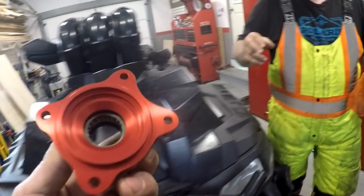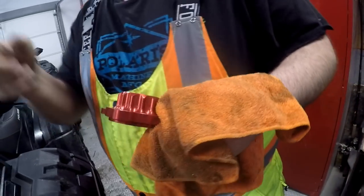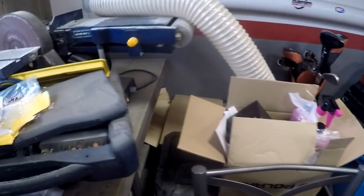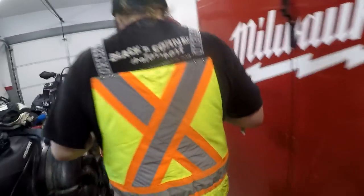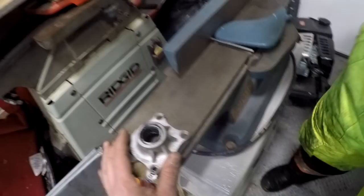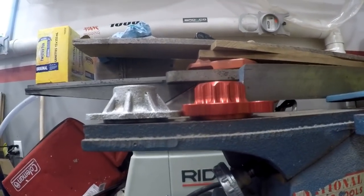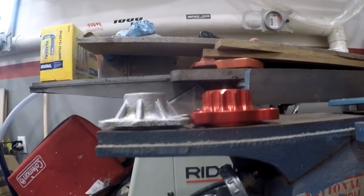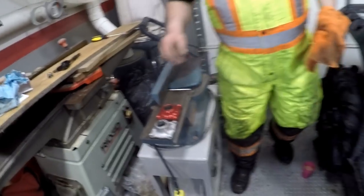Look at that. And that one gets the short bolt. Yes, the one side that's snubbed out a bit. Need my screws over there. Hey, Phil. Yep. Hold that one up versus the other one. I want to see them side by side, height-wise comparison, to see if one is actually truly higher than the other. Right here is a perfect spot. We have a machine flat surface. Yep, it's just a tad higher, not much, just a tad. So we might actually have to crack the diff bolts to get that extra little bit of slack.